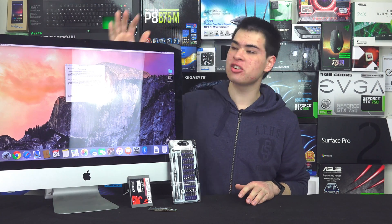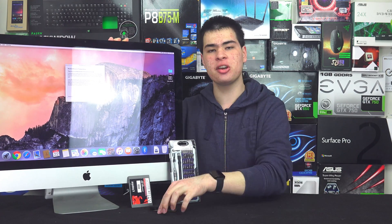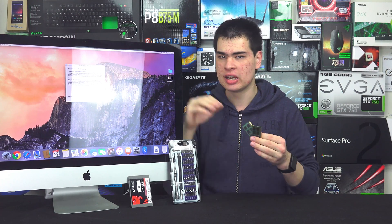So the iMac is nice, working, fixed, and basically back to how it was. It turned out it was one of those two RAM modules — they weren't exactly dead, just not compatible with the rest of the system. I tested them individually on different laptops and every time they came back working fine. It just turns out that when these two work together with other RAM sticks they just don't work for some odd reason, causing the system to sit there on a white screen.